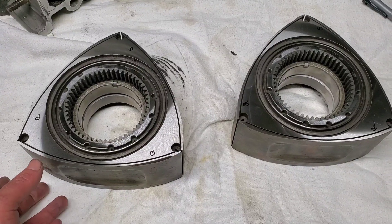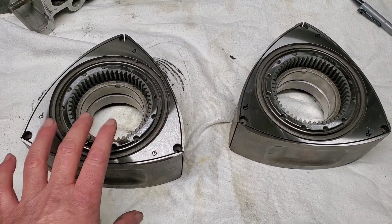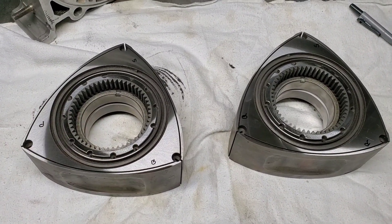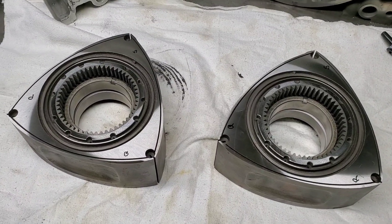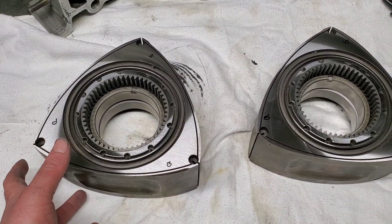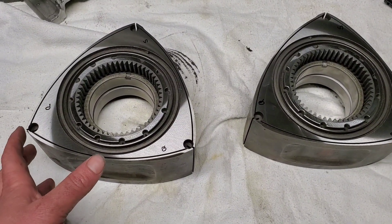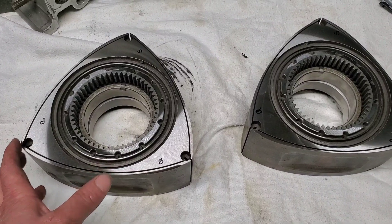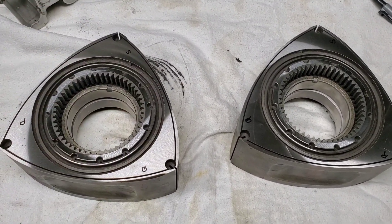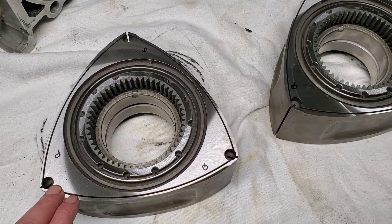This service is for boosted, naturally aspirated, high RPM — generally all performance applications where you actually need the rotor to have a little bit more tip clearance and land clearance, because the rotor is actually moving around more due to shaft flex, the RPM itself, the wobble of the rotor, and combustion movement. There's a lot of things that actually affect the rotor's rotation as it's in its trochoidal rotational operation.